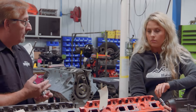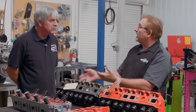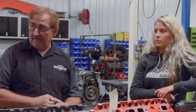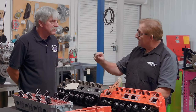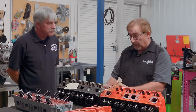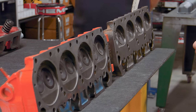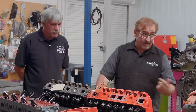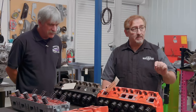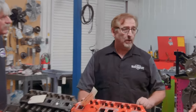However, that would make you think, well, a 67 440 would have higher compression than, say, a 68 440. It didn't. They both had 10.1. They changed the finish height of the piston to compensate for it. So the purpose behind it, I'm not 100% sure, but this had a 10.1 compression ratio and this had a final 10.1, unless it was a Six Pack, which was introduced in 1969 and a half, and they used an even higher piston and they were at 10.5:1 compression ratio.